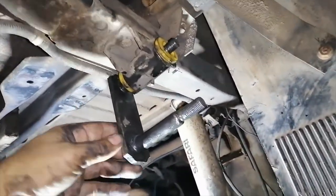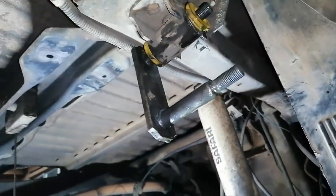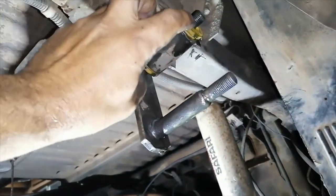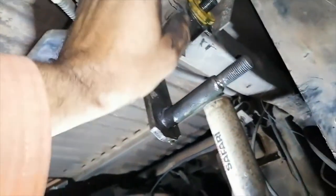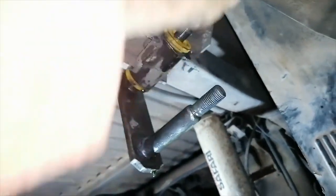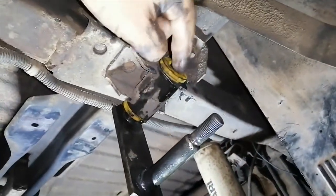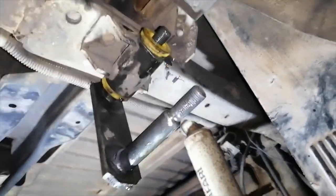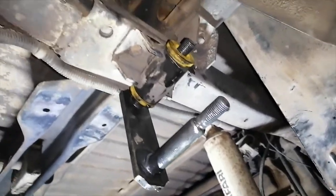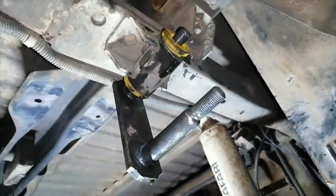Okay, so I put the other hanger in this side. That side there pulled nicely together. I put the hanger in on this side. So how I do it is, obviously the bushes were installed, and I put dishwasher liquid inside here, because that makes it nice and slippery. And then insert it and then start getting it from this side here, and then obviously she goes in.